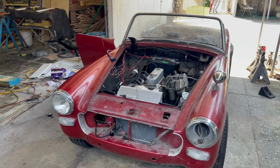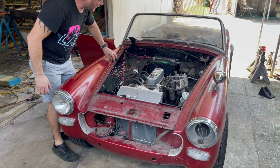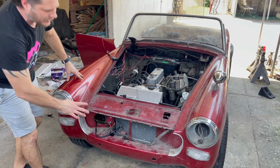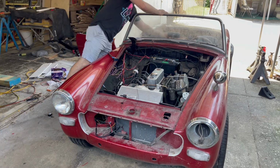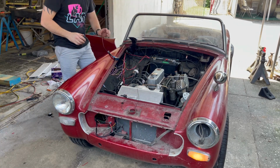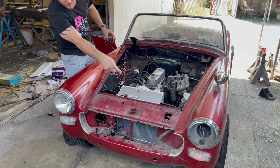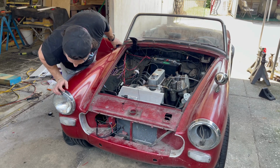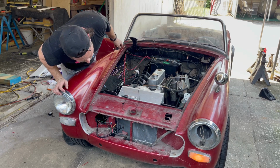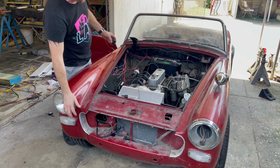All right, guys, so I went ahead and wired up the turn signal switch to this rocker switch and kind of just twisted the wires together here just so I could test everything out. Let me go ahead and turn the key on. I've got this thing grounded, and it's a little confusing on this switch, but as you can see, it's working over on that side there. And then when I switch it to this side, it goes, but then it turns off. And I've already went ahead and flipped it. See, it's not wanting to flash on this side.